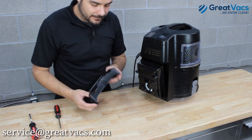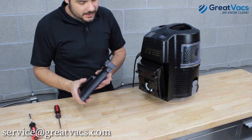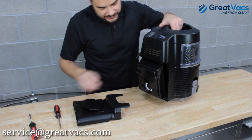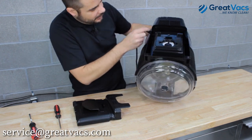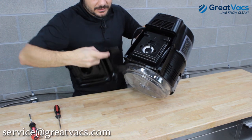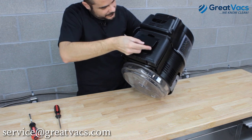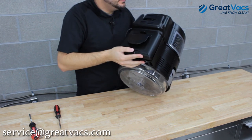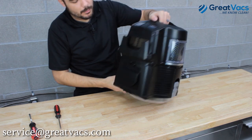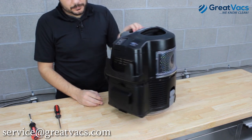Now to install the cover plate — there are little tabs on the top of the cover plate that you insert first into the vacuum to make sure everything is lined up. On the vacuum cleaner there's a little hole here and here that those two tabs on the filter cover align to. Once those tabs are lined up, simply snap the cover back on at the bottom. And that's it — that's how you replace and access the filter on the Rainbow E-Series.